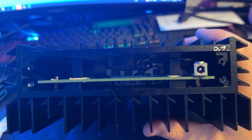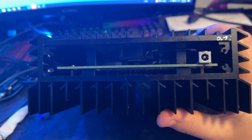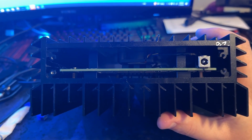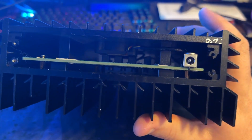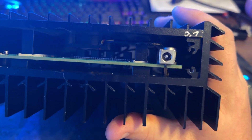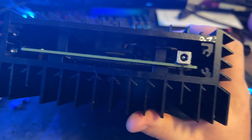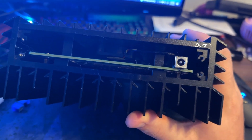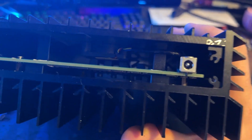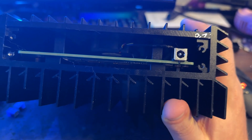But if you want to get the maximum out of this device, the TSwift software has come out finally for these, where you can get these all the way up to 700 gig of hash, which is absolutely nuts — and they're pulling over 300 watts at that speed. There's actually not a laptop brick that goes that high currently. What they're doing is using a 19-20 volt power supply and hooking up some 10-gauge wires and a connector, running 300 watts. I joked before about hardwiring these, and I did that on a couple of mine with a 12-volt power supply. At that kind of wattage, I feel like you should probably hardwire it rather than use these bullet connectors, or switch it over to a 6-pin connector — which I'm contemplating making. Someone was doing them but charging like 30 bucks for these 6-pins that are just bent and soldered together to fit into the slot instead of the rail connectors.